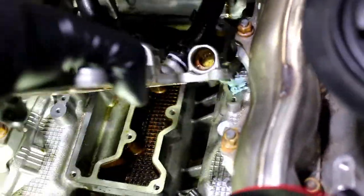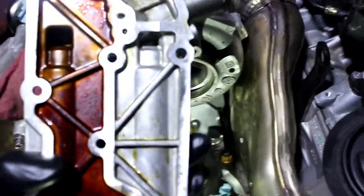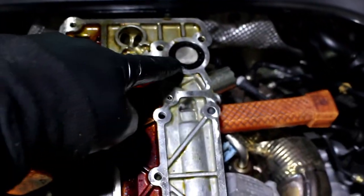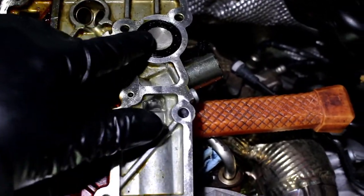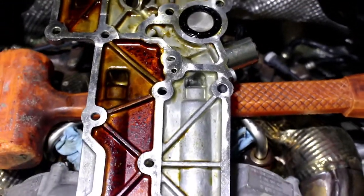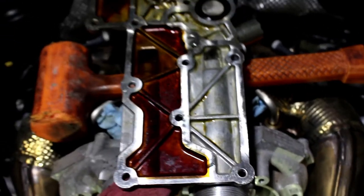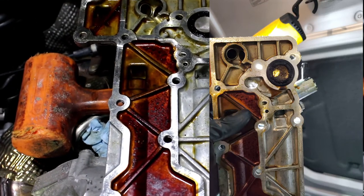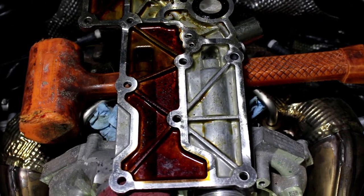This is what it looks like when it comes out — that's the bottom tray. And here is our under unit. Here is the oil filter screen — I cleaned it, as mentioned — and that is what gets clogged. Even after cleaning there are still some little bits in there. I'll put up a picture of what it looked like at 64,000 miles. This gets removed now; we don't use this with the new JH Motorsports aftermarket oil filter kit.